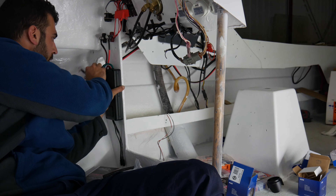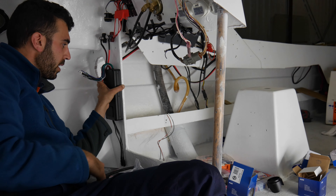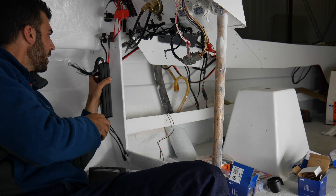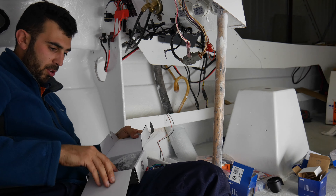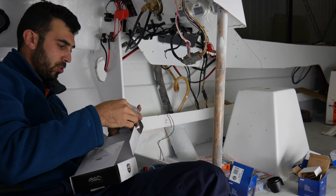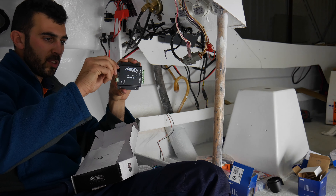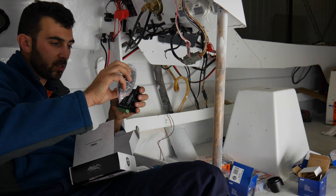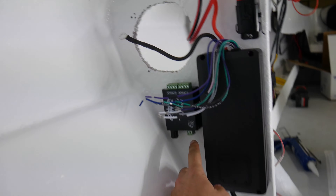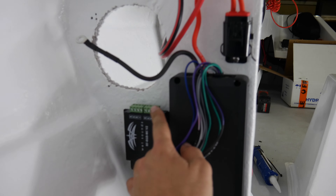I can just hook up the negative and the positive straight to the battery or straight to the terminals, all my speaker wiring down through the old speaker hole and into the pillars. Now these speakers are pretty fancy - they run red, green, blue LED lights in the middle of them and to run those you've got to buy this little controller, so we've got to install that as well. That is just a little amplifier-looking thing. You can adjust the brightness and it comes with a cool little fancy remote so you can do hectic colors when you're partying up with everyone. I'm pretty happy with that mock up. I just ran the controller on the side of the amplifier because I've just got to run a positive and negative single cable down to the bottom here and I've still got enough room for the knob and all the wiring that goes to the speakers.